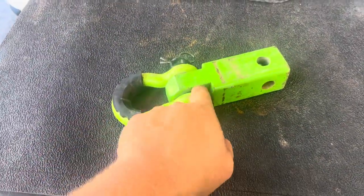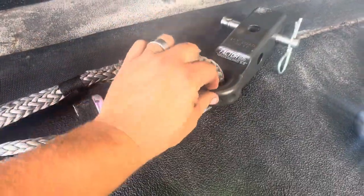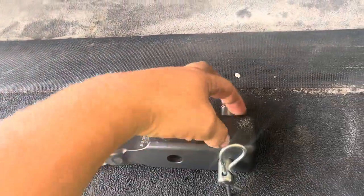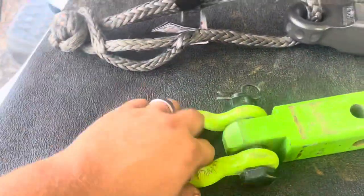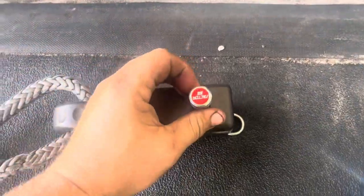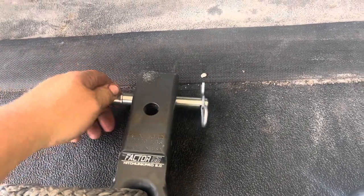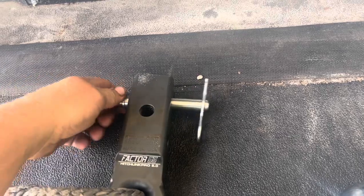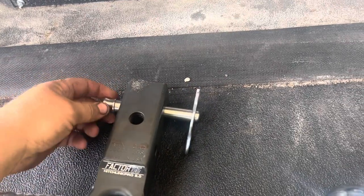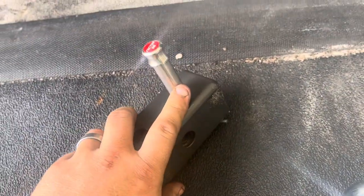If you get a shackle design, the hole inside often has a sharp edge so you can't use a soft shackle — you need one with a rounded edge. Either way, when you pull on these, you're pulling straight in line and the pressure goes directly to the pin. Some guy on YouTube said it doesn't matter what size pin you have or to just take the receiver out and use the pin — all of that is bad information. The Factor 55 pin is 303 stainless, 5/8-inch diameter, with a shear strength around 50,000 pounds.